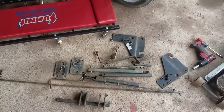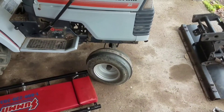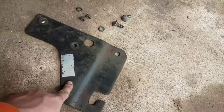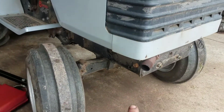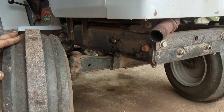We're going to start with the hitch, and we'll go from there. Actually, no — I've got to start with the frame brackets so I can jack it up, so I'll start with those. You're going to start with the frame brackets — you're going to need two carriage bolts with lock washers and nuts, and that's going to be going on here.